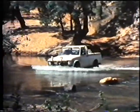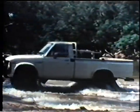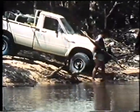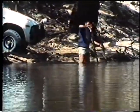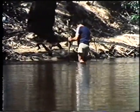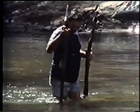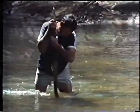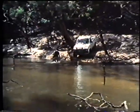If your vehicle is fitted with drum brakes, water will get between the linings, and lightly applying the brakes several times will dry them out effectively. If there isn't a causeway and the exit point is some distance upstream, where the river bed is muddy or sandy, the way across has to be checked on foot and the path marked with stakes to avoid any holes or big rocks. If the river is running strongly, the scout must take precautions to avoid being swept away, and a lifeline may be necessary.